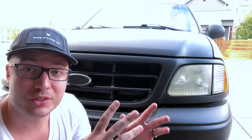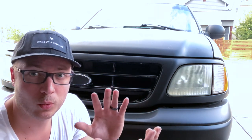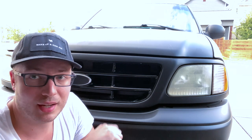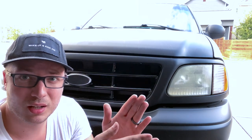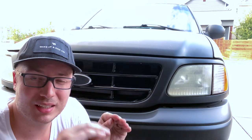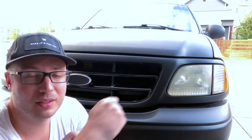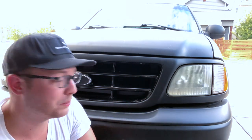So before I walk you guys around and show you the whole truck, I wanted to explain something referred to as wet peel and dry peel. So up on the windshield, for example, I left a gap on the glass where I started masking it off, because it's gonna be easier to just peel off excess Plasti Dip and let it create its own cut line than me painstakingly taping that in. And so in that area, I let it dry. I pull the tape with dry Plasti Dip because I want to peel that off with the tape.